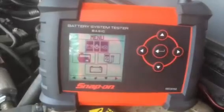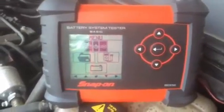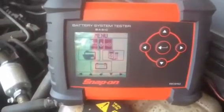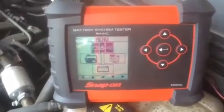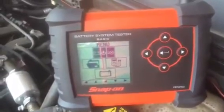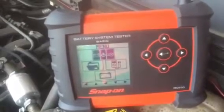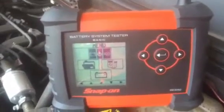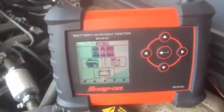As you can see we've got our main menus. At the top we've got a menu for testing the battery on the vehicle, then to do a starter motor test, and then to test the alternator. Below that we've got a folder icon on the left for our settings options, and on the right we've got our voltmeter for general voltage readings. Below that is the symbol of a battery which enables us to test batteries — the 12 volt lead acid and the 12 volt AGM — off the vehicle as well.